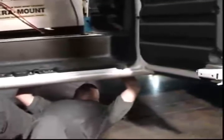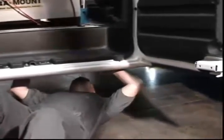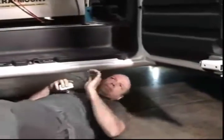Measure and position the mounting holes on the tank supports over the chassis frame of the van. When measuring, check for lines and wiring that might be in the way when drilling. Drill and bolt to the frame in four places when possible. Bolt to the van flooring when access to the frame is not possible.